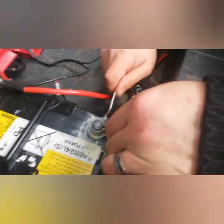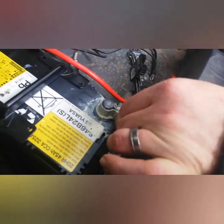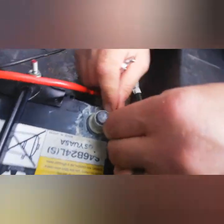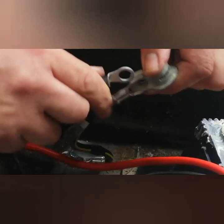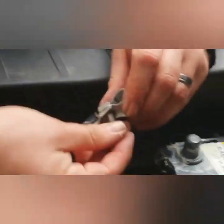You need to put the eyelets on the other side — not in between the two joints — because otherwise your negative terminal won't be clamped onto the battery tight enough. Where the bolt is, that's the side where you put your eyelet. If you insert the eyelet in the wrong place you will not be able to tighten up the clamp onto the negative terminal — this is not how to do it. As you can see, with the eyelet on the outside of the clamp it can now be tightened up and a firm grip made on the negative terminal.